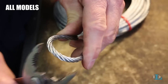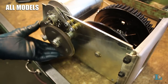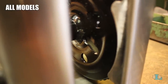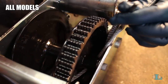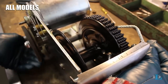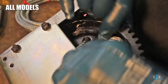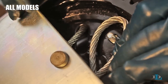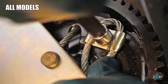Before installing the new cable on your winch, the process will be easier if you use a standard set of pliers to put a kink about 2 inches from the end of it until it looks like this. Rotate the main gears until the reel slot that you just pulled the old cable out of is facing the bottom front of the winch. Slide your new cable through this slot, then it is crucial that you also slide the cable under the outside of the reel. Then rotate the gears again so the cable faces the top front of the winch. Use your hands to bend the cable at the kink, then slip this newly created loop between the winch's reel and base. Insert the carriage bolt through both the reel square hole and the loop in the cable. Set the cable clamp on top of the bolt with the cable under its winged edges, put the nut on the bolt, then firmly tighten it with your 7/16 inch wrench. The entire cable clamp area should now look like this.